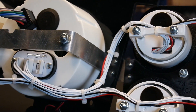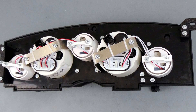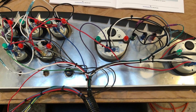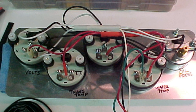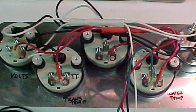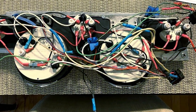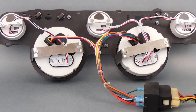So let's go over the wiring — this was the biggest obstacle customers of all gauge installations faced. When wiring a traditional kit, each gauge requires its own power, ground, lighting signal, and signal wire. Then each of those needs to be commonized through a hand-built harness, crimped and soldered, then somehow interfaced through the vehicle through another hand-built plug. This was all up to the customer to do, and this is where 90% of installation errors occurred.